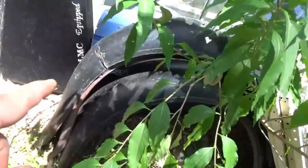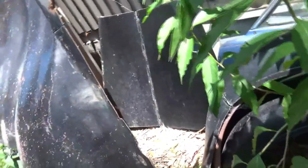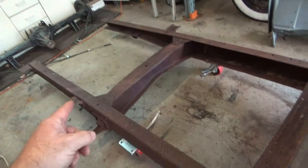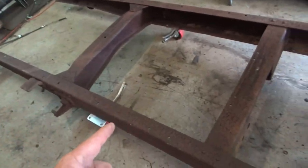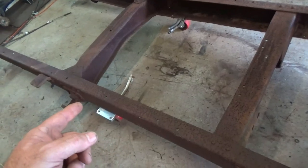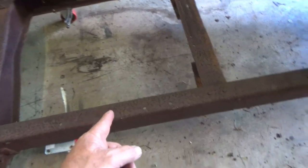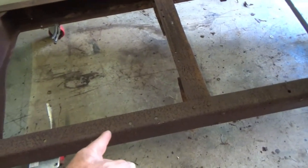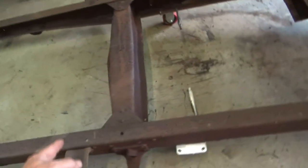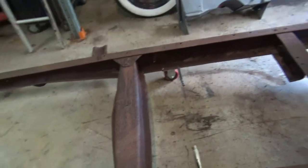There's my rear fenders, front fenders, and there's a bonnet which probably won't fit. This chassis is going to be cut down - it's quite long at the moment. It's going to be cut down to 106 inches, like the small pickups and the sedans. The wheels are about there, and then I'll leave on whatever I need for the tray. So I'll leave the back of the chassis on and just get rid of that short little bit at the back.